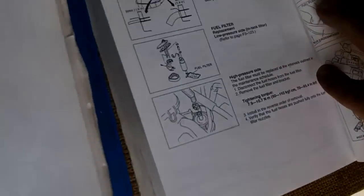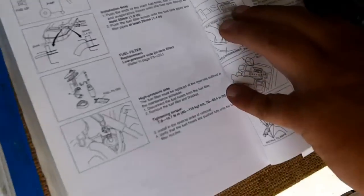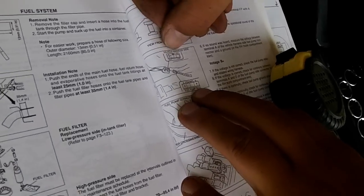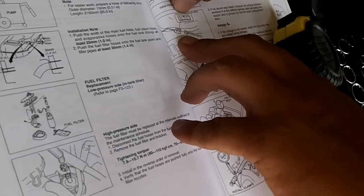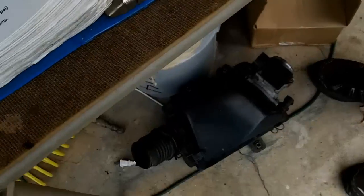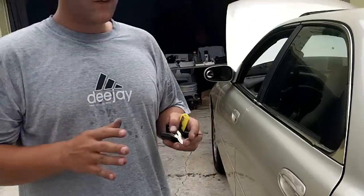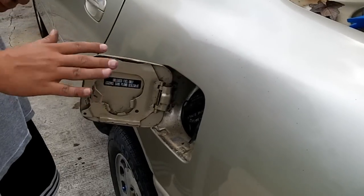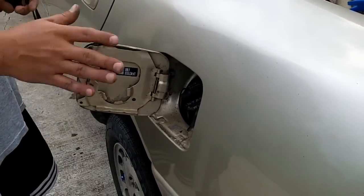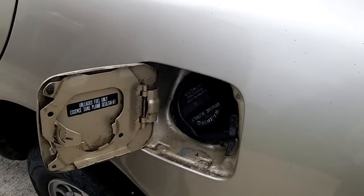This should be a four pin harness with fuel pump side and vehicle side. We want the vehicle harness side — which is the top clip — to measure the left port. What we're looking for is the voltage getting back to the fuel pump. We did hear sound, so we're going to do a hypothetical to help people out. If your fuel pump does not turn on, if you do not hear a sound — and that goes for every single 626 and for most cars ever made — when you turn the key to on you should hear your fuel pump begin priming or engaging.